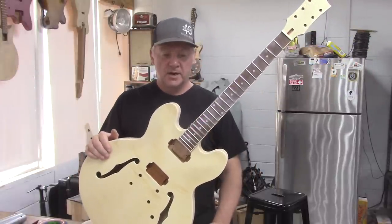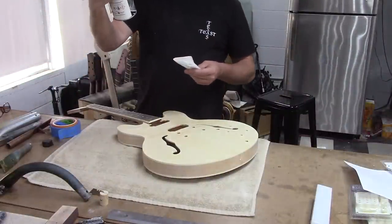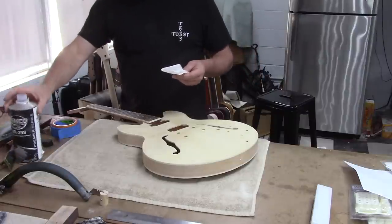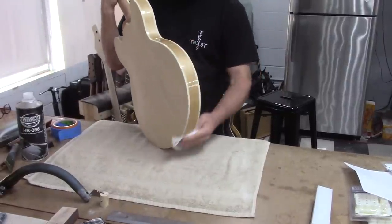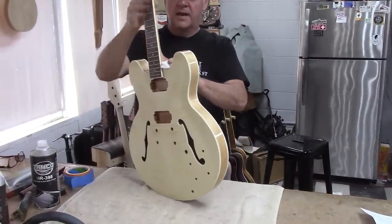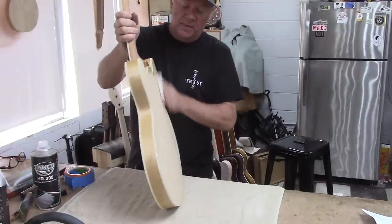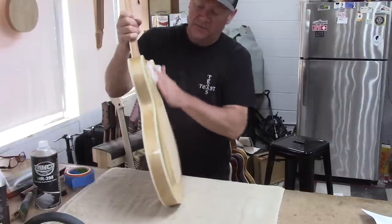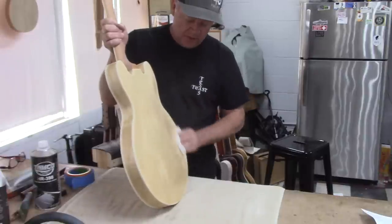So let's get started. So this is naphtha? This is naphtha. Auto parts stores sell it as final wipe and anti-static cleaner. It's grease remover, but I think it's naphtha. The reason to do this is to get any grease that I may have gotten on it off it, and I realize I'm touching it with my hand. Before we spray, I'll wipe it all down again. But I did also just wash my hands. This is just to make sure the tape sticks better? Yeah, I do this before you tape to make sure that the tape stays, because little pieces of tape don't always want to stick.